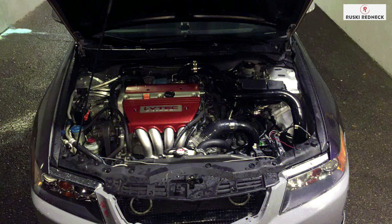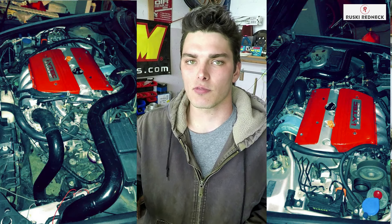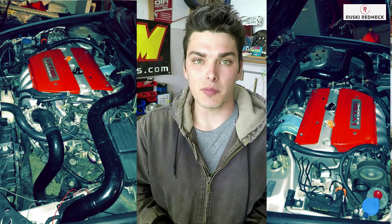The two reasons I don't strongly recommend the CX Racing kit: one, I think that kit looks pretty ugly — I don't like the way the piping is routed in the engine bay. That's just my personal opinion and it doesn't matter because it's your car. Second reason — from my experience running that same exact turbo, when I swapped over to the tubular style manifold I ended up making more power, and the power felt a lot more smooth across the entire board. According to my tuner it has something to do with back pressure in the manifold.